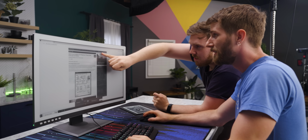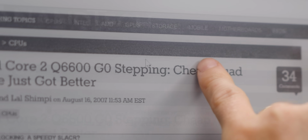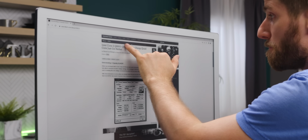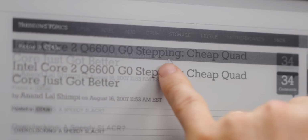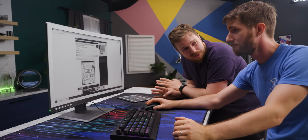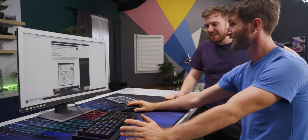And you can really see it when you look really close on dark colors. You can see it's just not filled in. That's because the e-ink doesn't make it to the surface in time for your refresh. And it's much darker, even if the ghosting is absolutely still present. I wasn't sure how fast it was, but I think I could literally count it, and I think it's 4 frames per second. Time to view video, I guess?